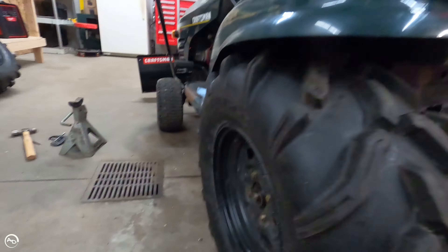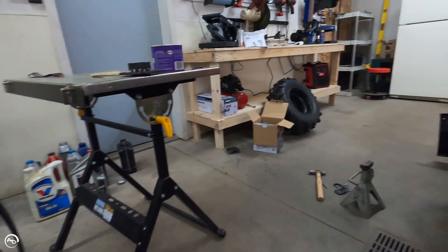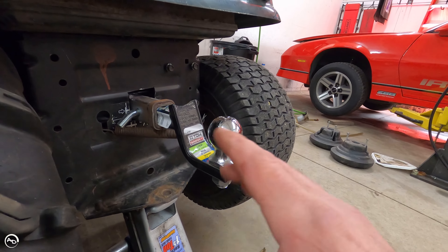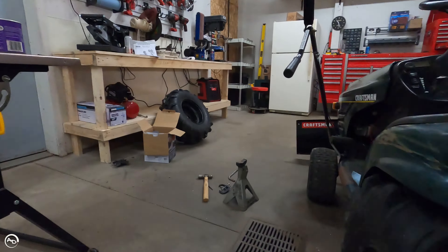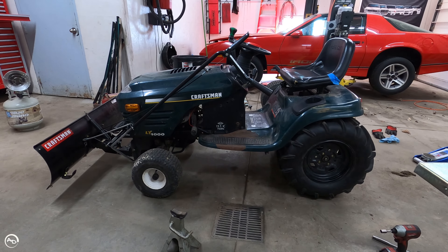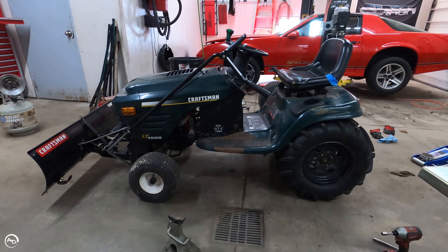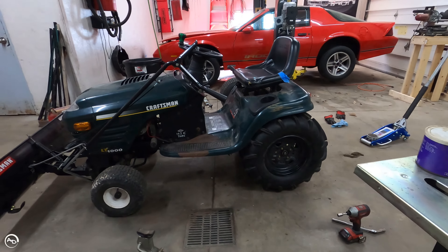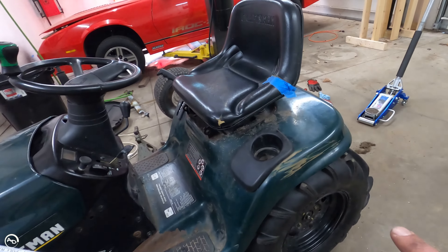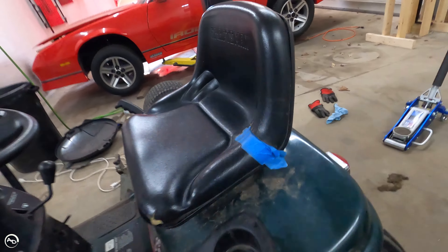It was such a tight fit I figured it would be easiest to do it this way. I did utilize the set screw. I got everything on, I put the regular retainer clip back in, keyway's in, axle is all greased up, and I have the set screws in there. This should be really nice where she lives — it's just in between the edge of the fender and here. I'll put this back on, then you guys can see what it looks like, and then I'll start working on the other side. It's 25 by 11 R12. This side was super simple — nothing really over here to interfere, everything lined up really well.